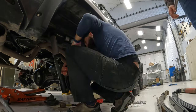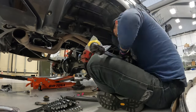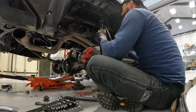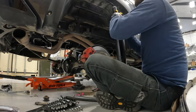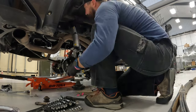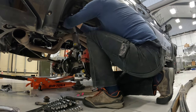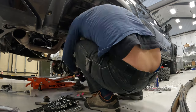Put the new shock assembly back in. Full disclosure: I ended up putting it in twice, because the rear shocks are directional. You align that plastic roost guard to the front, and there is a passenger side and a driver's side. I did not take good enough note of that during my first install, so I had to put that rear shock in twice. Now I have all the experience.